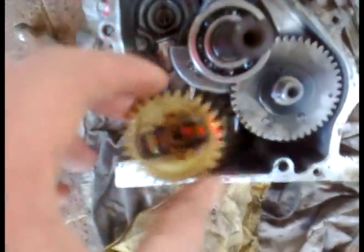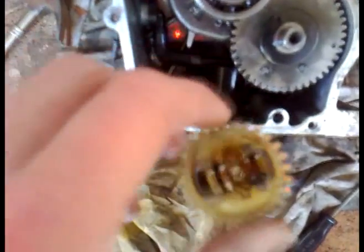You can't just remove the arm without removing this little plastic gear — it's nylon or polyurethane. I think it works like a clutch: when the engine goes too fast, it throws those weights out and slows it down. Because it's plastic, it's only good to around 3600 RPM. If it goes to about 4000 RPM with that plastic gear still in there, it'll shred and throw bits around, chewing up your cam, crank gear, and lifters — doing horrible damage. So you've got to take it out.